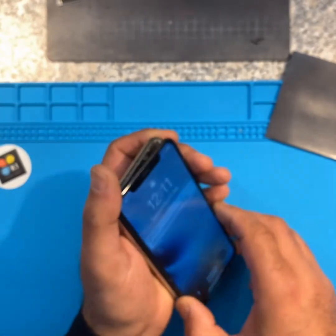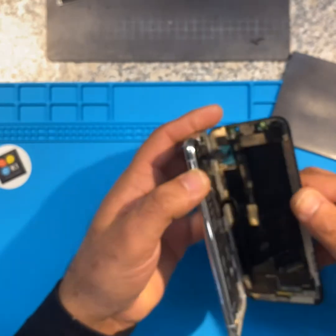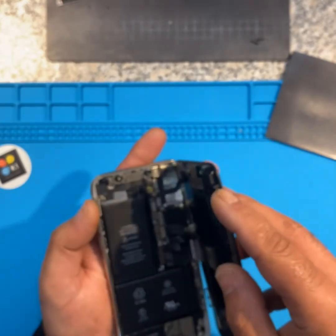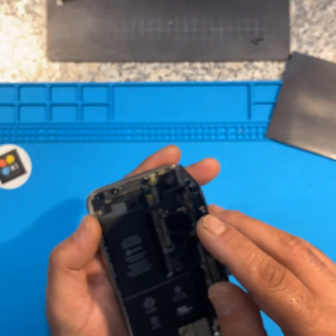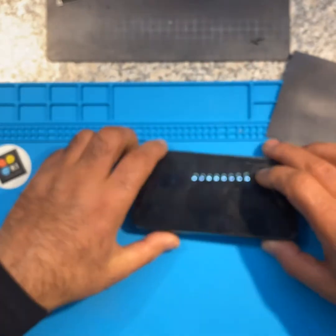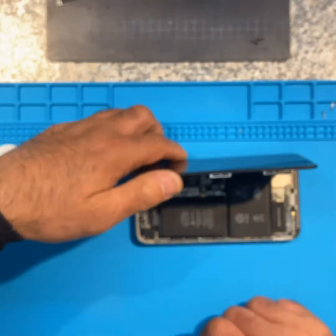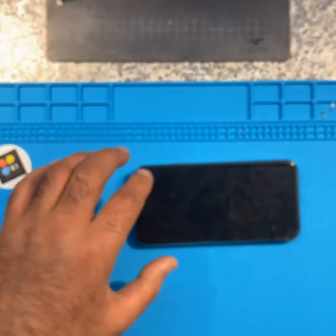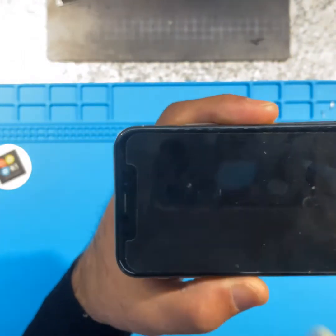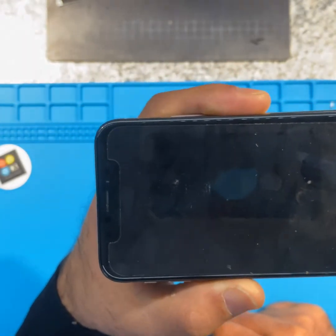It looks like - one second - when you change the screen, you see, this is a replacement screen as well, and this is the reason Face ID is not going to work. Let's have a look, it's got a PIN number in there - check the cameras. Yes, it's got a PIN number. Let me show you again: the phone is on, we disconnect the battery, there's no battery connected, we plug the charger in, the Apple logo comes out, and as soon as I'm disconnecting it, it goes off - it means it doesn't take any power.